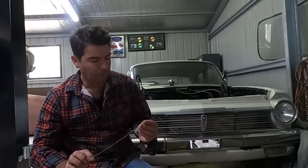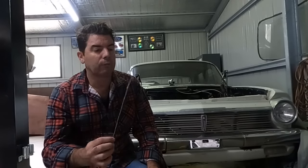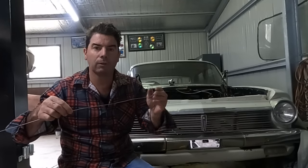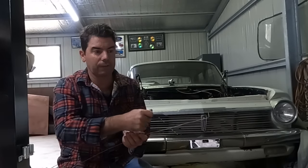I've never really made that many brake lines, but a number of years ago, a mate did the brake lines in the EH and made them all. And one tip he did show me was use stainless steel wire. Now I don't have stainless, it's nice and soft and easy to straighten. This is just plain old fencing wire. And bend the line up using the fencing wire, because it's easy to bend, you can get all your right angles in, and that way you also get your length. So you go along, you can cut your brake line, straighten the length, so you've already got the length unfolded, and then you just mimic this, use this as a template.